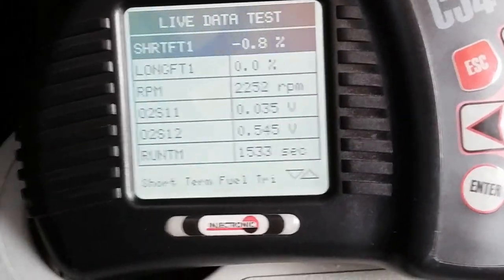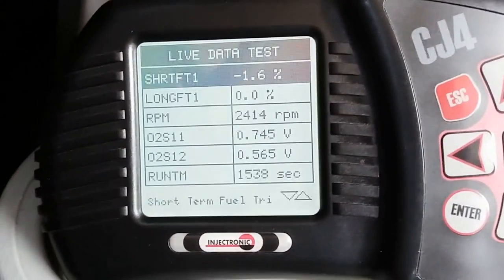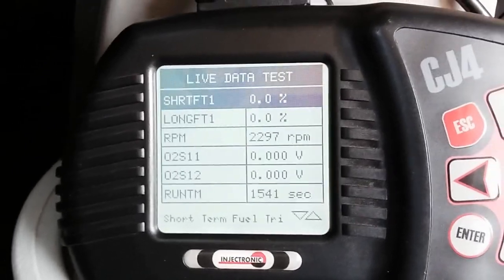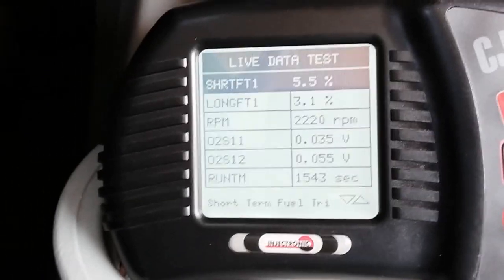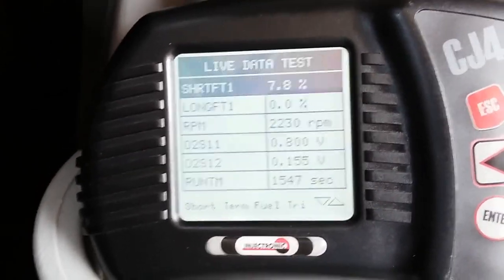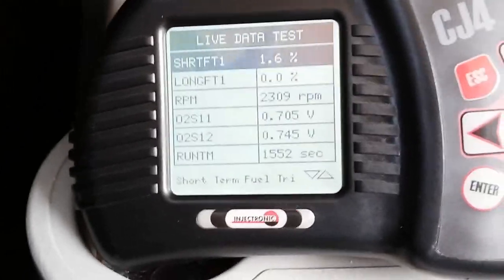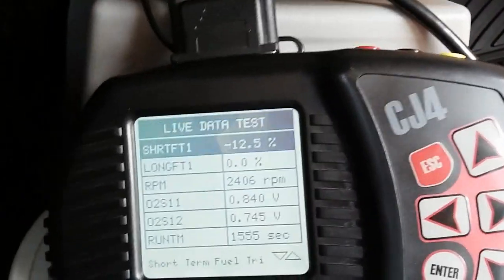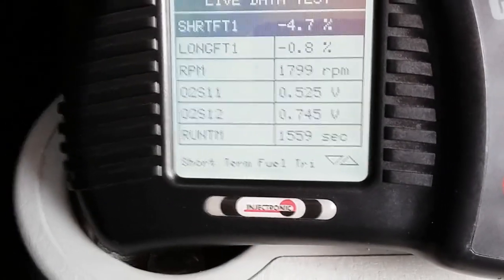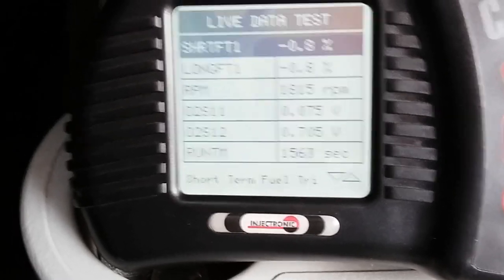For a moment I was kind of bummed out, especially during our injector balance test, because I was actually expecting a much lower drop test, anywhere from 33 to 34, but it was the same drop test of 39, which is a difference of 16 psi, from 55 to 39. But so far during this 25 minutes, I really feel confident about this injector replacement, so I'm gonna call this a fix.